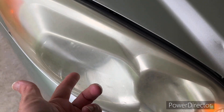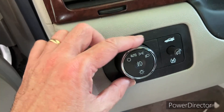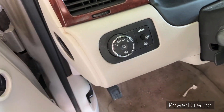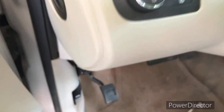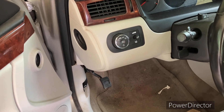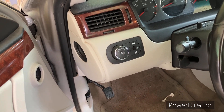Around the front you can see this one is on the driver's side and this one is not, so we know it's this outer bulb. This is an easy job. Cut this back to auto so they automatically come on when it gets dark. Pull this and I'll pop the hood, I'll go get some more tools. Fortunately I already have another headlight bulb, I'll show it to you also.